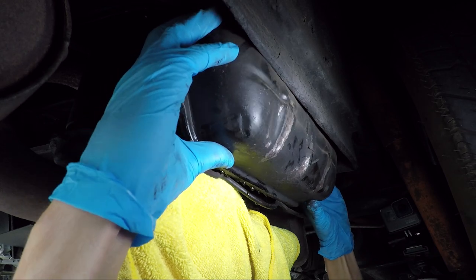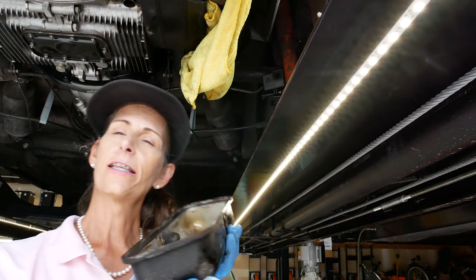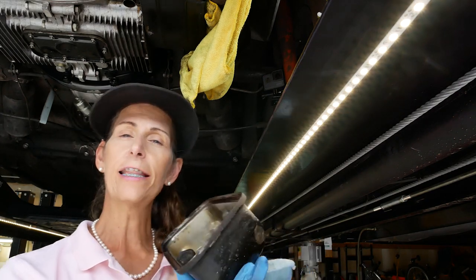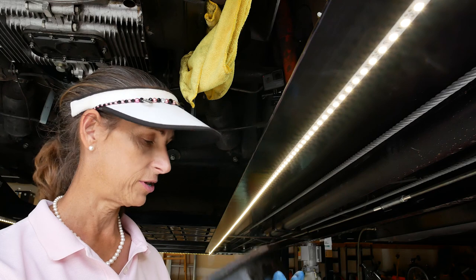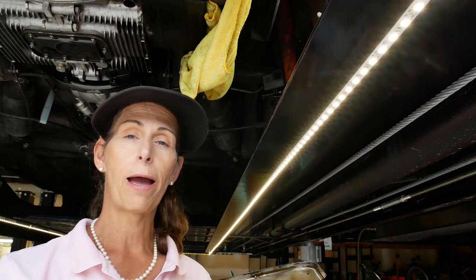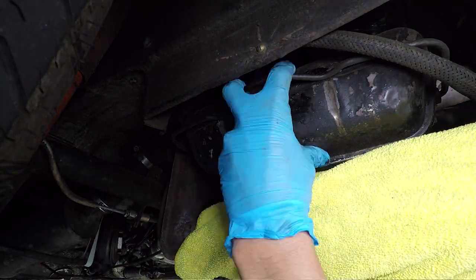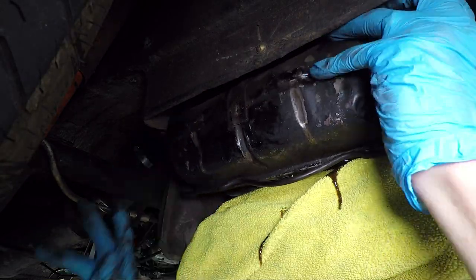There's a cork gasket on here and a little bit of oil can drip — that's fine. I like to take this opportunity to clean everything really well: clean the outside, clean the inside, and look for any metal bits or anything that really shouldn't be inside the valve covers. These look fine, just a little bit of oil. Now on the left side we'll do the same thing — put our rags up there, get the bailing hoop off, and pull the valve cover.